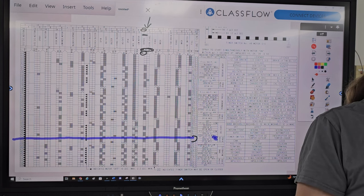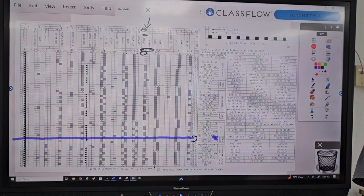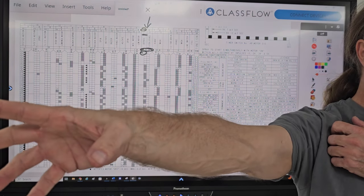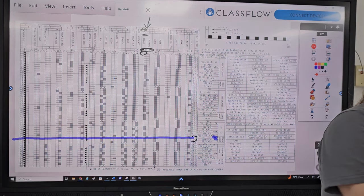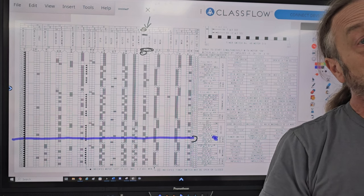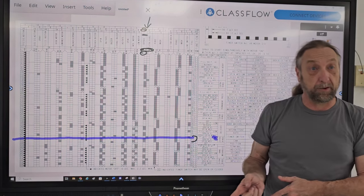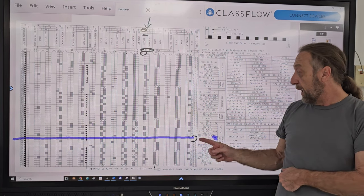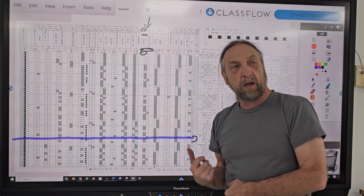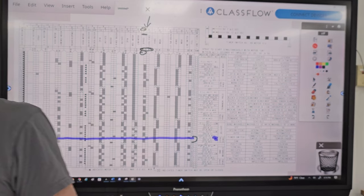But on a lot of the top loader machines, the motor drives the pump without the pump itself having its own motor. The main motor that drives the transmission is the motor that drives the spin and also drives the pump. So if we run the motor at a low speed while we're trying to drain the water, we might not be able to drain out the machine sufficiently. Now, while we are spinning, it's still draining. Does anybody know how many gallons per minute an average washing machine will pump out?